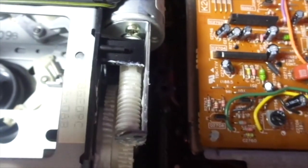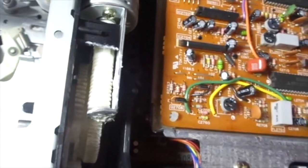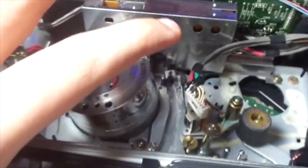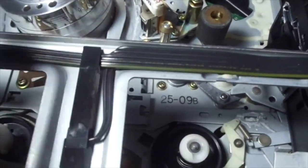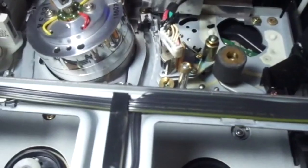This cassette carriage uses a separate motor to drive it instead of the loading motor, unlike other VCRs. Some older VCRs had a cassette carriage motor to drive the carriage. I greased every gear on there as possible. There are more gears underneath that have been greased. The tape wasn't going in — power on — still wouldn't go in. It uses a separate switch to activate it. The top of the cassette hits the switch and triggers the motor. So that's pretty nice.